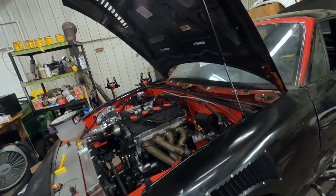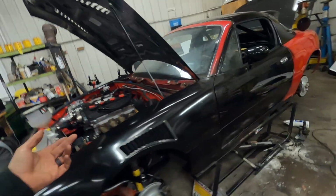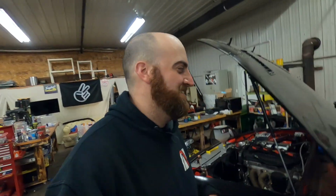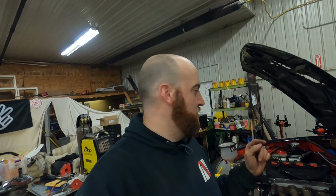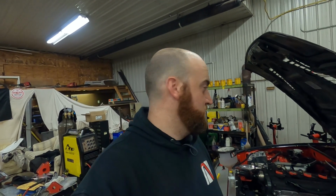Actually, it starts up, and when it is idling, it idles nice. Even with those AWR 95 durometer engine mounts, it definitely shakes a lot of things, and we're going to find some loose bolts. But the episode's not over. We're going to pick you guys up tomorrow when I am swapping in the other injectors. Hopefully we'll see if it idles and revs up and runs not 18 to 1 AFR. Either way, big progress. I am super pumped. It's been a long day, so see you guys in the morning.